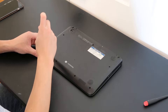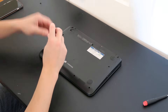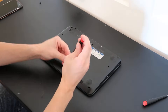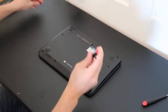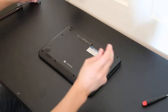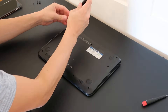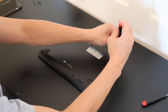Take your screwdriver and just go around the edge and take out all your screws. One thing I like doing when you're taking apart a computer: not all the screws are going to be the right length and width for all the threads, so as you're taking out the bottom case screws, keep them separate so you know they're your bottom case screws, separate from other boards, heat sinks, and whatever else.